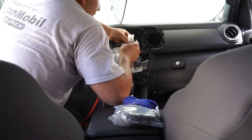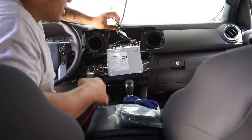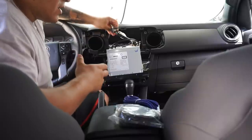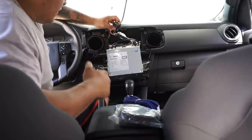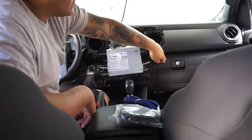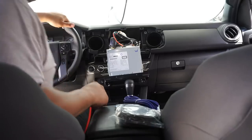Just make sure all the wires add up when you plug the harness in. Now before we run our RCAs, one thing I've always found best in 10 years of installing car audio systems: run your RCAs on the opposite side of your power wire. The reason is you want to avoid any engine noise, which also goes along with having a proper grounding cable on the amplifier. My power wire is going to be on the driver's side, so I'm going to connect my RCAs and remote wire, run them through the back of the glove box down the bottom panels, all the way back to where the amp's going to go.